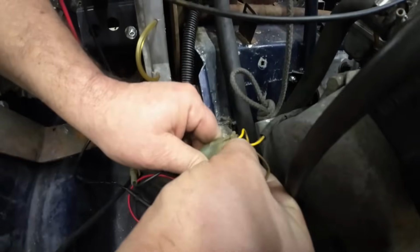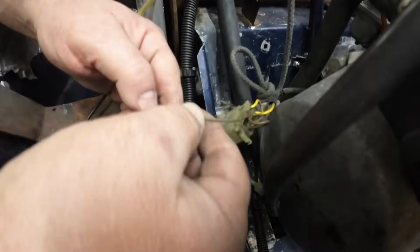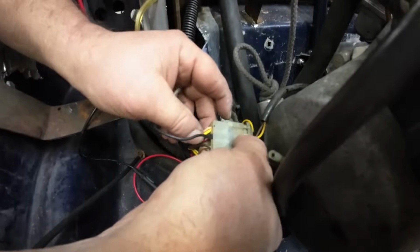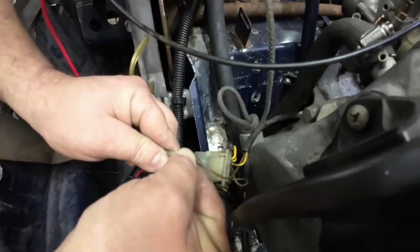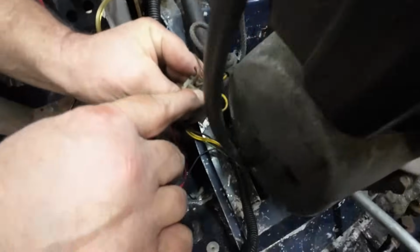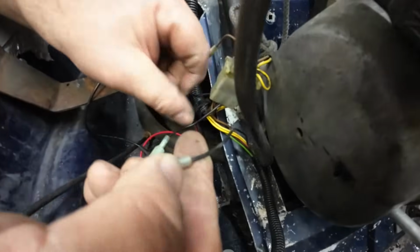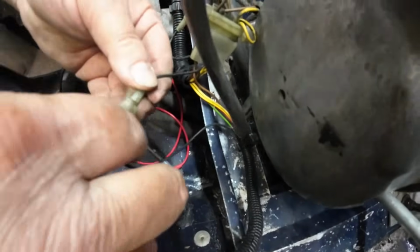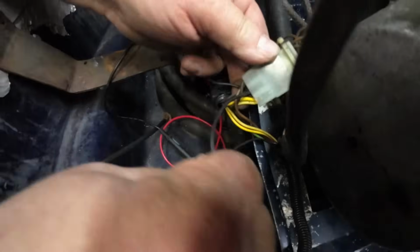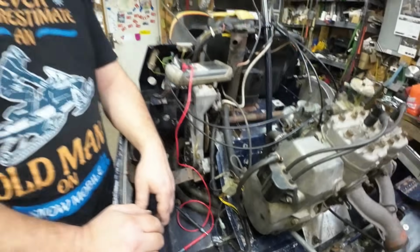So here's the deal. When you plug them in together, you got two sets of plugs that look like this. What goes where? All right, this black one that's coming off of this black wire all the way up to the switch here just gets plugged into the brown for the engine ground. Then the other one, the red with white, you can see there's nothing coming out of there. Well, it looks like there was once upon a time, but it doesn't matter. When you have an Indy 500, you have this one lone connector on the CDI. So we're going to switch the plug, and when we connect it to this, which connects it to this red wire with a white stripe, that'll be enough to complete the circuit and kill the motor. So hopefully that wasn't too long-winded and complex, but that's how you work through it when you're swapping engines, at least in a Polaris. That's how you make sure your kill switch works.